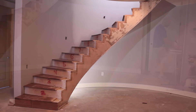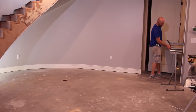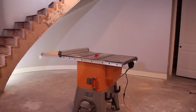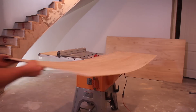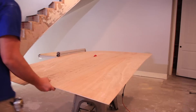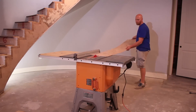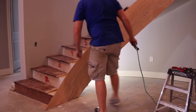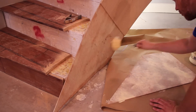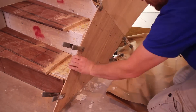At this point I'm ready to begin adding more curved pieces of quarter-inch Luan plywood, which I'm ripping into 16-inch strips to then be attached to the inside of the stringer. More layers, more Titebond red, more clamps, more staples.